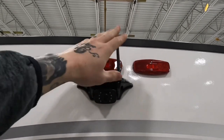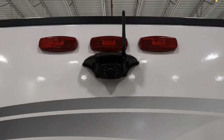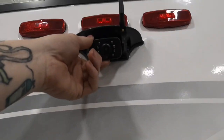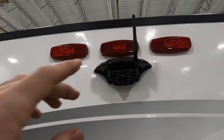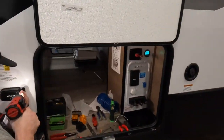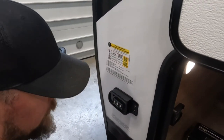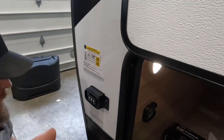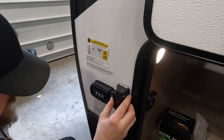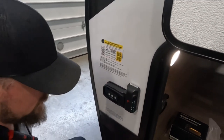The main thing is just showing you guys how easy it is to install. In the case that you open a box and it's not paired, which I find to be very rare, you simply go to the options and go to pair rear camera — there's a pairing button on the bottom here. You would press to pair the camera with the screen, which is the same thing you do for the side cameras. Since this coach is getting side cameras too, I can show you how easy that is. You're really just going to pull the marker light off and reattach the power. You can determine if you want the turn signal trigger to activate it. Most of the time we install them where the camera is always active, so you can leave all three on the screen at the same time. You can wire them how you please and the instruction manual will give you both of those options.